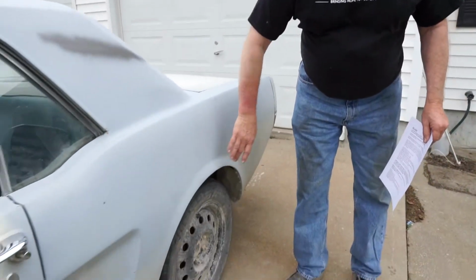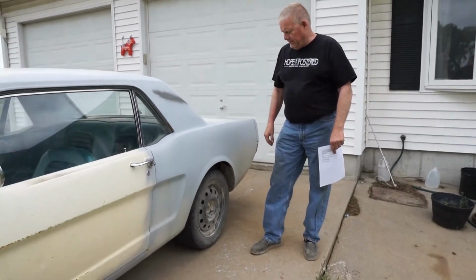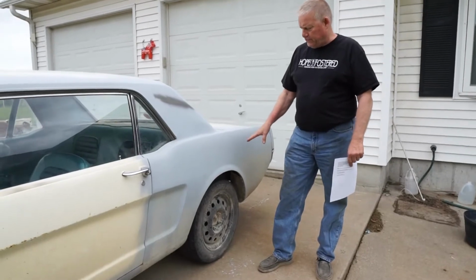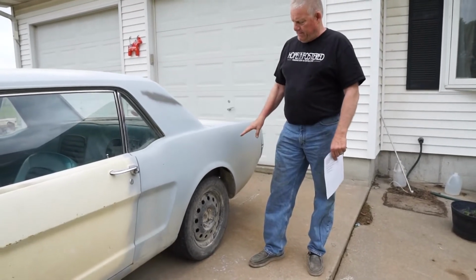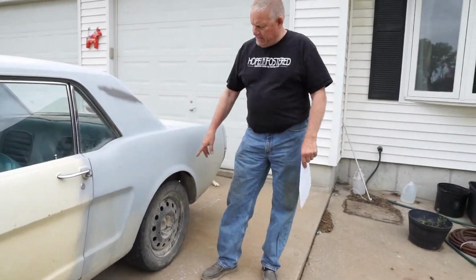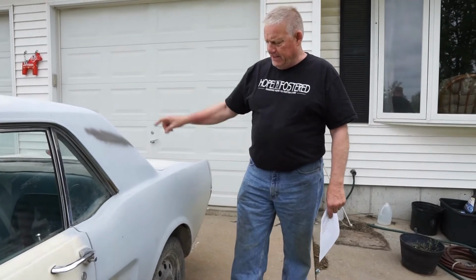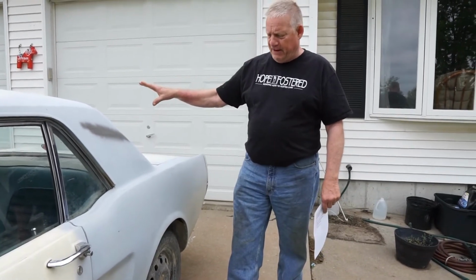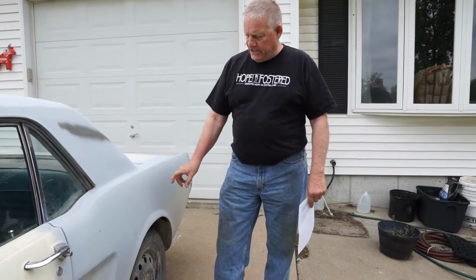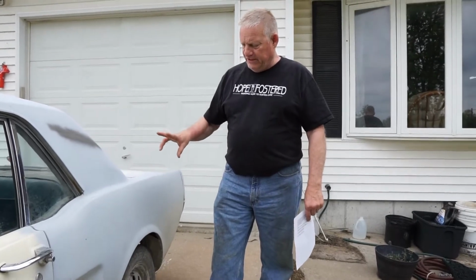On the back end, I got a rear axle out of, I believe, a 1996 Ford Explorer. It's the 31 spline disc brakes. Now, these things fit, but they don't really fit, because they're wide enough that you have to use a little bit different wheel to slide it under there. If I had it to do over again, I would get one axle off of the passenger side, which is pretty cheap, and narrow one side before you weld on your spring perch for your leaf springs, and then just slide it under there. It'd fit a lot better.